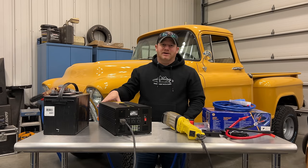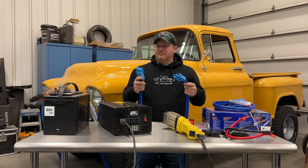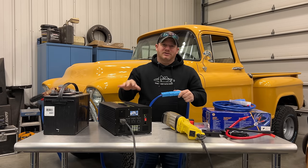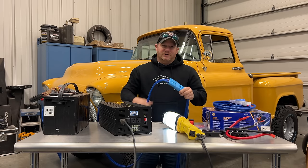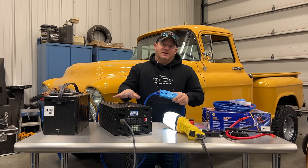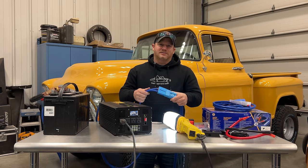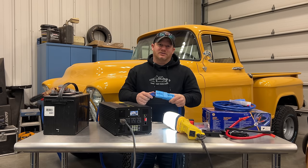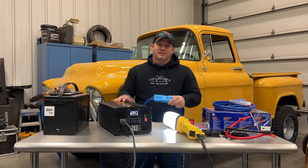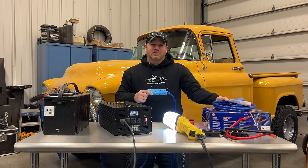What I've done now is the wires come out of the back of the inverter and go to a big heavy-duty connector. The other end of the jumper cables has another one of these connectors, so when I connect the two together, the power goes from the battery to the inverter turning the light on. The great thing about having this attached to the inverter is that now you can use your inverter with many different configurations and many different vehicles. If you want to use the inverter more often and more like a generator, you should think about permanently installing one of these connectors to your vehicle.